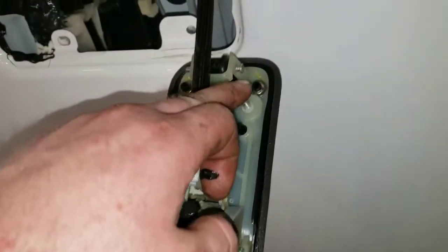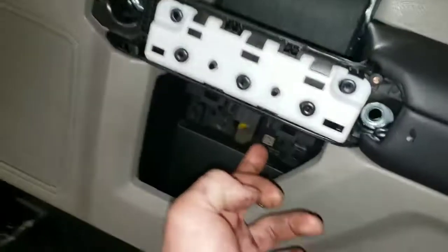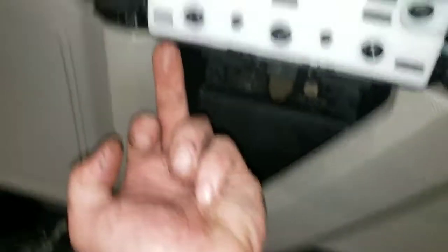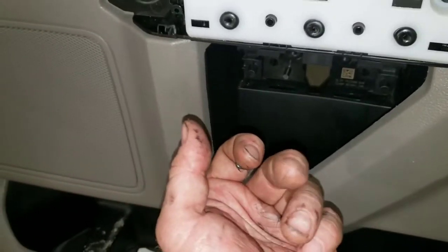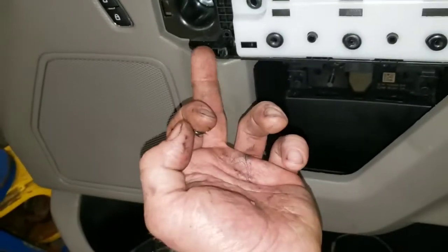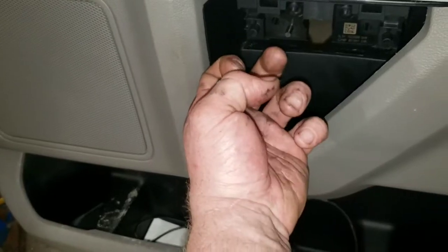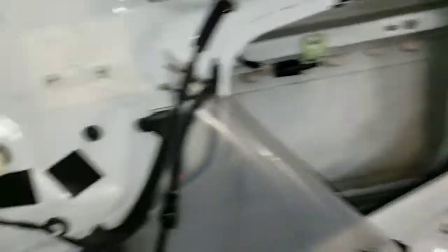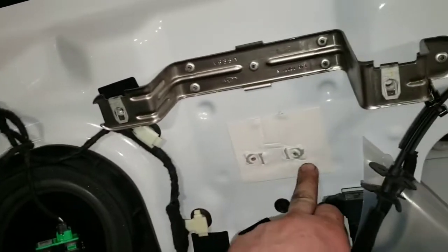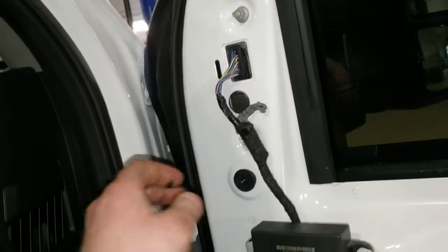Basically all it is, is a 10mm here, a 10mm here, and a 10mm here. Then on your door panel, when you take it off, you've got a 7mm behind this little cover, a 7mm here, and a 7mm here. If you get up behind this plastic trim piece right here, you can flip it off — it's almost going to seem like you're going to break it — but you pull it from the front side and the little locking tab comes from behind it. Pull from the front and roll it out. For this one, get a pick back behind it and pop it off. There's a little 7mm down at the bottom, another 7mm at the bottom, ones in the handle, ones that go through the door, and then pop this plastic piece off and there's a 7mm right here.